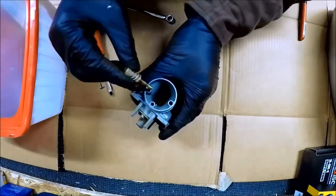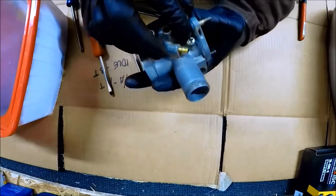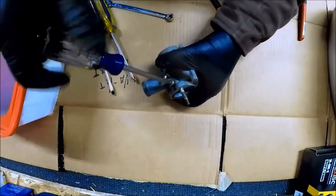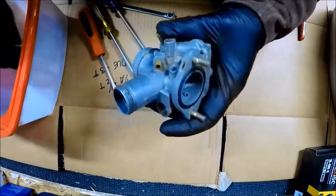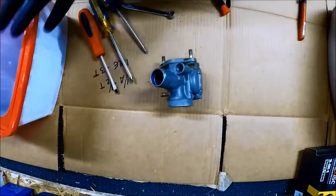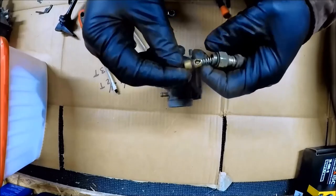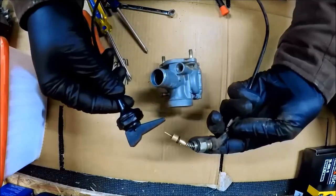The more of this I can get opened up and the more solvent I can get running through here, the better. I don't think this screw does anything — it just goes to a hole on the inside, I don't see where any air comes through — but I've come this far, so I'll take this one out too. The choke assembly goes in here, and like I said the carburetor didn't have it, but I was able to buy the choke cable. These are hard to find, so I've got two of them now. It had the choke assembly on the end, so I'm not going to take it apart — I'm just going to run it through the ultrasonic cleaner and replace my whole choke cable with this one.